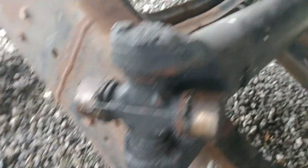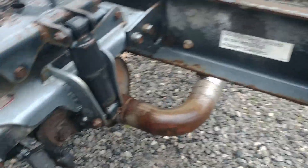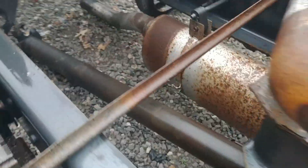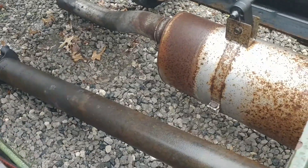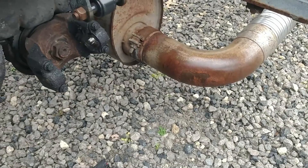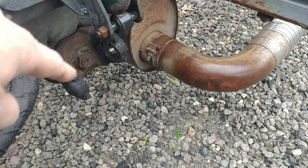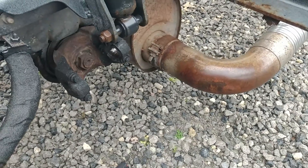Here's another one, but it's got 1610s on either end, so that one's not going to help. Here's the chassis we just took the wheels and tires off of for another truck — it still has the front section in there. I measured these up and they're 1710s. So that might be the yoke we need right there if the spline is correct, so we'll get that off of there.